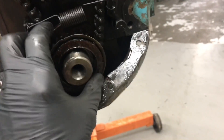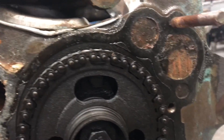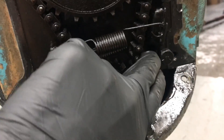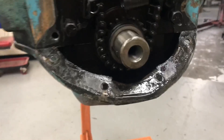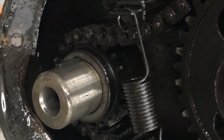Take a look. Check the tension around there. Well, it doesn't look like it would have jumped a tooth or anything. Got a little bit of slop in it, not as much as I thought it would. So I guess this begs the question: how loose would it be if we undo the tensioner? Let's take that off and see how much slop we have.